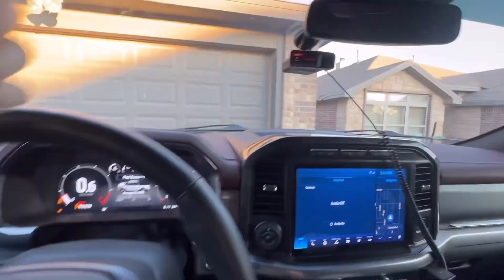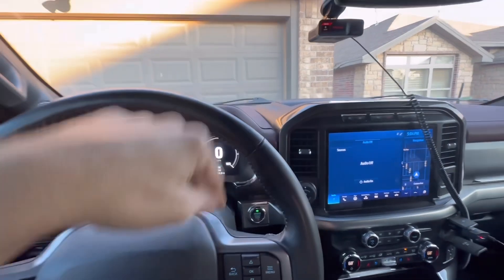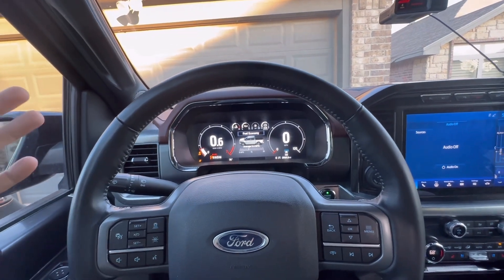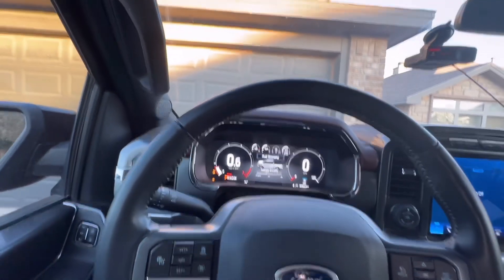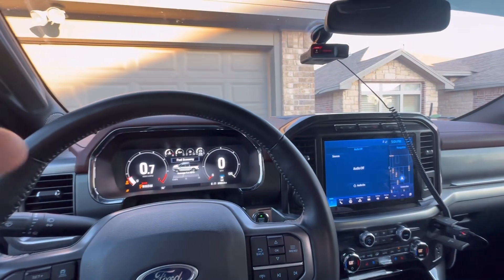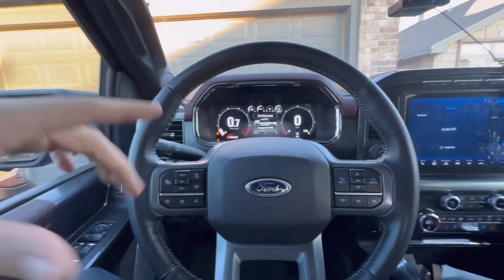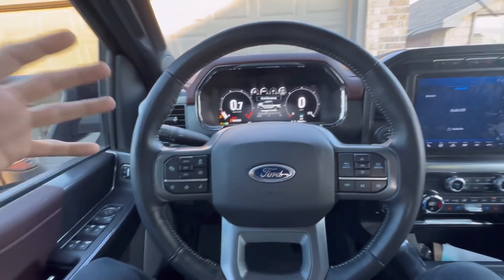I have a GPS radar display, and I found out that if the speedometer reads 105, the truck's governed at 106 but I'm actually doing about 112 mph. That's because the factory tires were about 31 inches and mine are 34.6 inches — about a three-inch diameter jump — so the speedo reads about 3–4 mph low at highway speeds. The gap widens at higher speeds. Even so, the truck had plenty of power — with cruise set at 90 on a leveled truck with 35-inch tires, it was effortless.